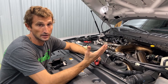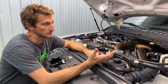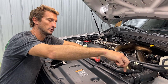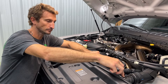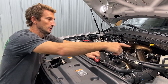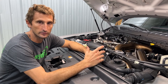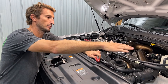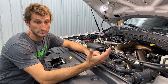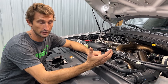The first step is obviously going to be to drain coolant because we're working on the coolant system — I've already done that. It takes about 10 minutes to drain the coolant out of the petcock on the main radiator, which is on the lower driver's side corner. Open that and throw a five-gallon bucket underneath — it fits no problem. Drain about two gallons or so, since we're working on basically the highest part of the coolant system. If your truck is older and it's been a while since a coolant flush or thermostat swap, it's a great time to do that.